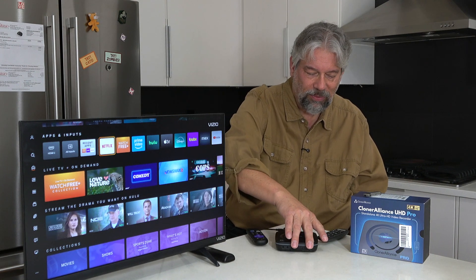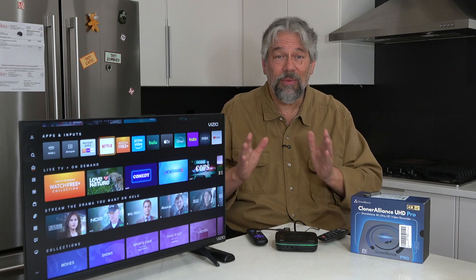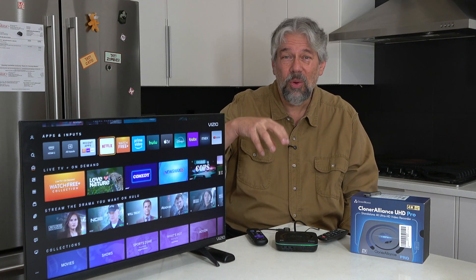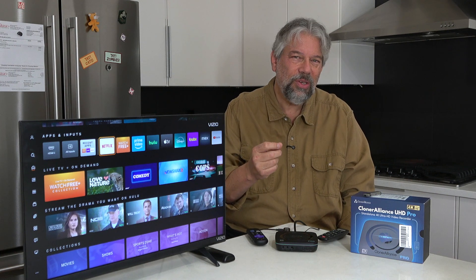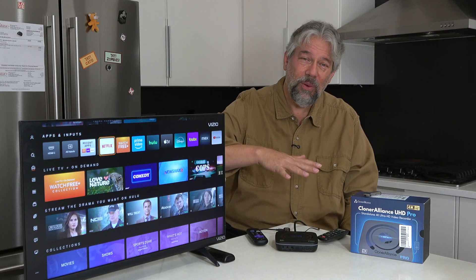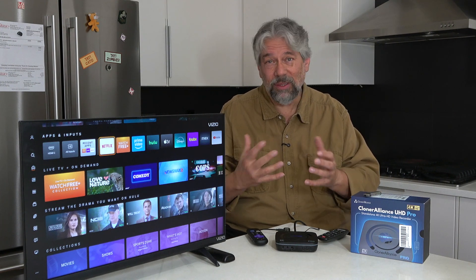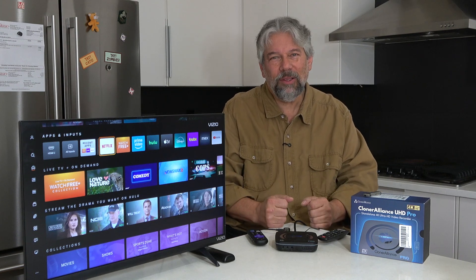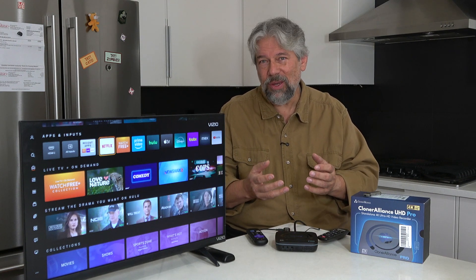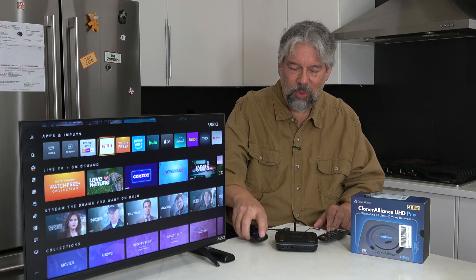It's flashing blue and green, which means it's not happy about the input, so let's just reboot it. H.264 and H.265 are two common video encoding systems. H.264 is much more common — it's probably what all of your computers, phones, and tablets use — but it tends to make larger data files. H.265 is a little more modern; it makes smaller files by about 40% because it has a better compression algorithm, but it's very new, so a lot of devices can't handle H.265. You'll have to choose between those to figure out which one you want.